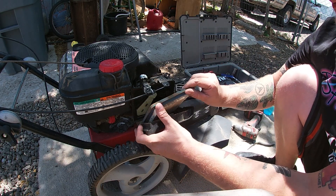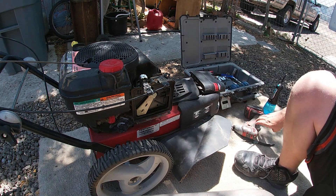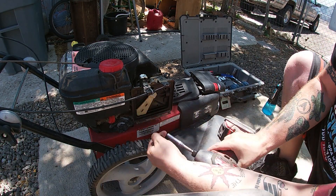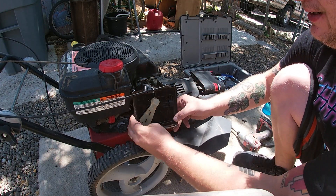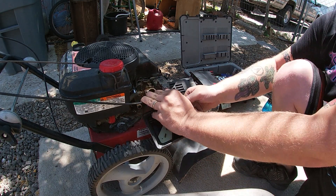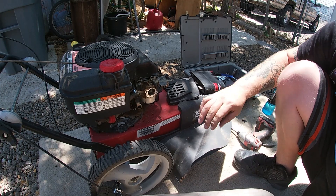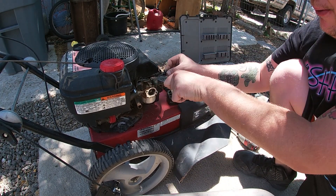The air filter is okay, it's gonna work. Now we got three 8mm bolts. This is actually a pretty simple carburetor to work on. A lot of people just don't like it, and this is why I said you don't need that special tool — because now you can just take the C-clip and get it out of there, like that. That was for the throttle here, which could use some PB Blaster at the end.